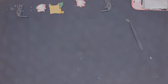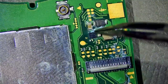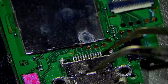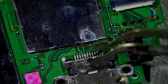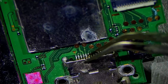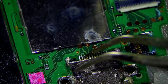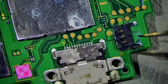Here we go to the microscope. That's what the corrosion looks like. Some water damage there, and a little bit there. Those pins aren't looking the best either. This looks like an original factory port — the old school ones where there's no back on them, and the pins that tend to break. They all seem to be pretty well connected still, so I'm not going to mess with them. The corrosion we're going to take care of.